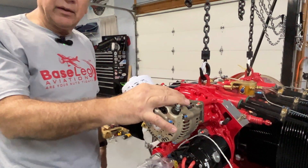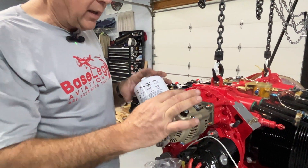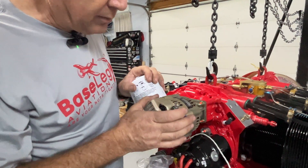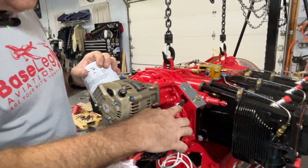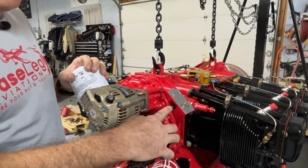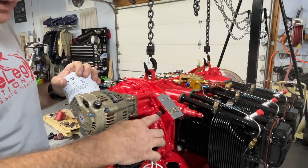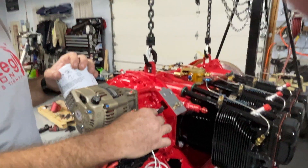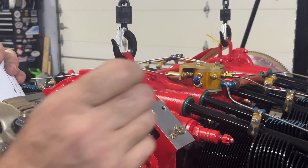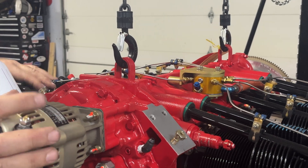One of the things I believe in — and I know many of you are aware from some of my columns — is a standby alternator. I've already put that on. I like putting on what I can prior to actually mounting the engine so I'm not laying on my belly trying to do it. We've got the oil pressure pickup right here. This is a restrictor fitting — you want to make certain you do that for fuel manifold pressure and oil pressure. Basically it's a restrictor with about a 60-thousandths hole. We're just measuring pressure so we don't care about flow, but if your line were to break, with the 60-thousandths hole we're not going to get much leakage before you have a catastrophic engine failure.